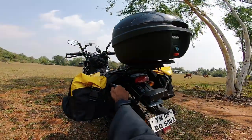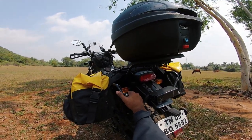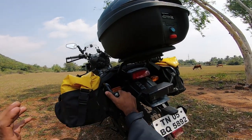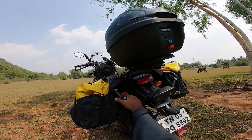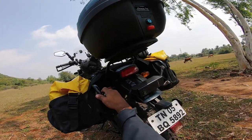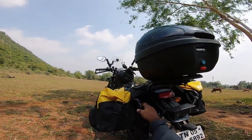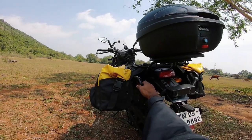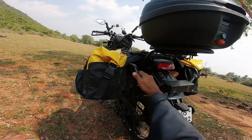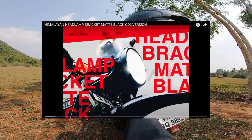And the usual saddle stay from Royal Enfield, again pretty solid. I had an aftermarket one which couldn't take a lot of crashes. It started to bend and cave in, but this one here is rock solid. At the most, what happens is that the paint starts to chip off or it starts to rust, and that's the usual scene with 90% of Royal Enfield products. They start to rust because of poor metal quality here and there, where it is not a must. So what you need to do is give it a nice scrape with sandpaper, and then go ahead and do your primer and paint, and that's it.